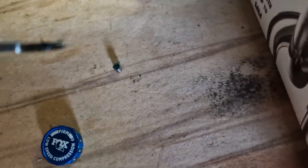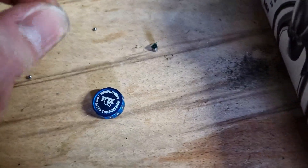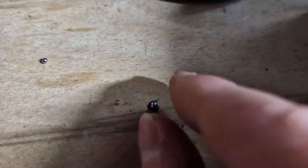You have to make sure you haven't pulled the spring out — make sure the spring's still sat in there. I've got a little bit too much grease in there, and then in the top of that you have to be careful because one of the ball bearings is smaller than the others, and that's because it sits in the top position.